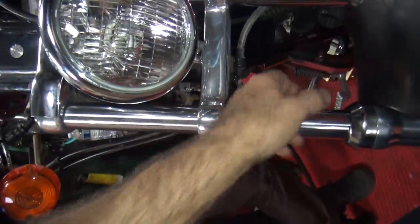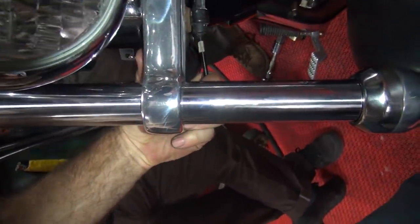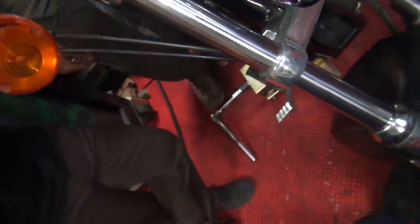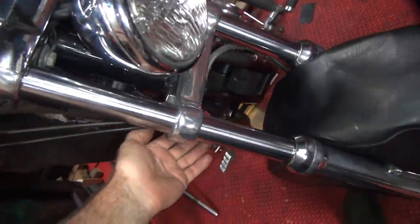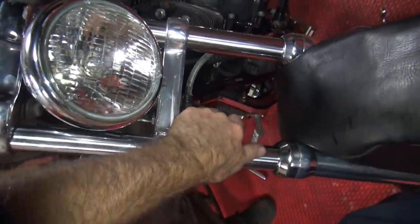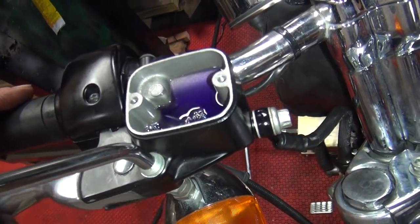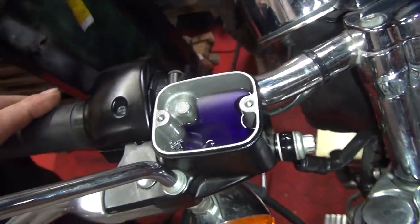So you've got to make sure your line doesn't have an uphill like this. See how that goes downhill right there? That's bad. Air will collect right there. That's built into the system. Well, if we take off the fitting right here you can compensate for that. Or if you take the bolt off right there, you can compensate for it. So I'd say pull this bolt out down here — it's going to get that out. It might even be this one. It'll be a 3/16.